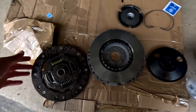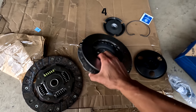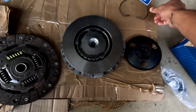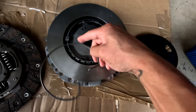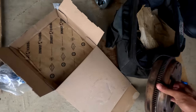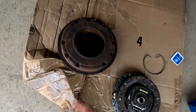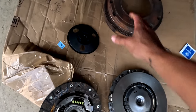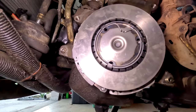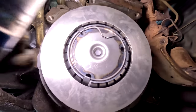This is actually my first time doing a clutch on an eight-valve. Normally you'd do the flywheel to the block first, then the clutch plate and pressure plate on top, but on these it actually goes pressure plate first. Then there's a little piece that sits inside to cover the bolts, a snap ring that sits under the grooves with two ends going into the holes. After that the clutch plate sits on the inside, and the clutch alignment tool holds it centered. The pressure plate is in with all bolts torqued to 44 foot-pounds and a quarter turn after.